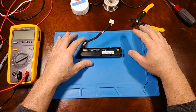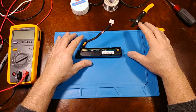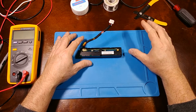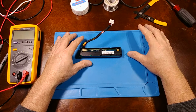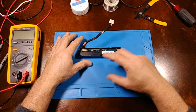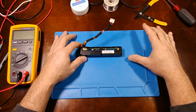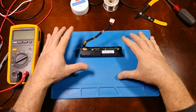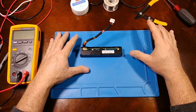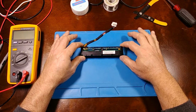And so that data that's written to that memory is vulnerable if there is a power failure or some kind of interruption in power to the drive array controller while that data is in the RAM and not on the disk itself. So what this battery does is keep power to that RAM so that when the server is powered back on, the RAID array controller can write that memory to the drive. And so that's what this battery is.